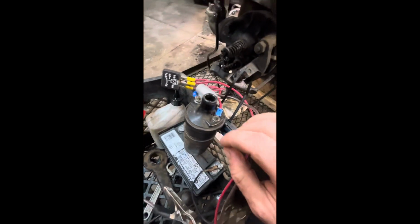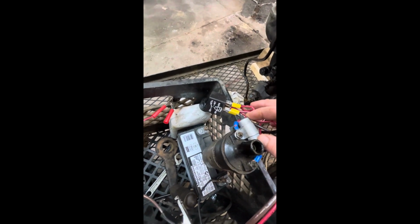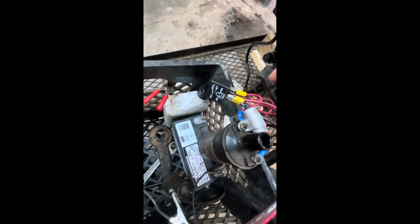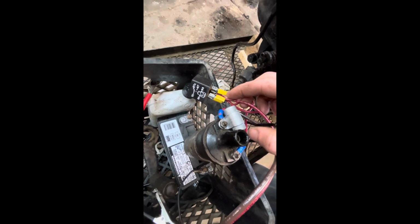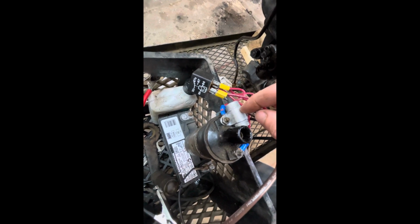So first things first, start with your ignition coil and your condenser. Take your condenser and strip the wire that comes off the end if you had a loop, and take a 3 feet piece of wire and crimp a spade terminal to the end of that. So you'll have a 3 feet piece of wire and then your condenser crimped together with a spade terminal. Then you're going to take the ground strap for your condenser and put that to the positive post on your coil.